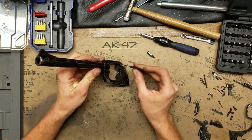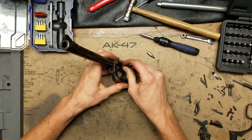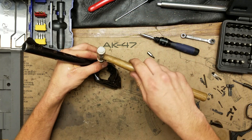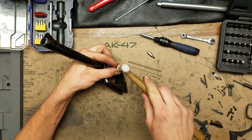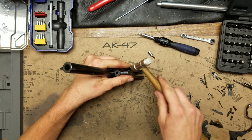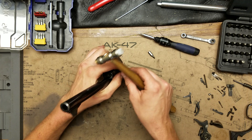All I'm doing is putting the punch in one of the holes and tapping it with a hammer. Got lucky that this one isn't all seized up — there could definitely be a lot of carbon buildup around here; it probably wouldn't hurt to use some penetrating fluid and soak this part. While it's out I'll probably go ahead and make a proper tool for it so when I'm putting it back in I won't have to do this again.